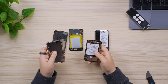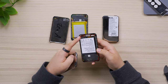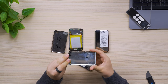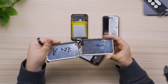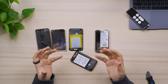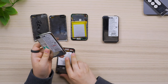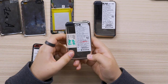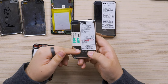After cracking this open, we can notice some differences. The most major one would be the actual board — from the little bits you can see, it's completely red. On the back, we have this same sort of Zen text, which they did for asset tracking or parts control on these early first-gen iPods. For comparison, let's jump into an EVT 2 iPod. This is later than the red board pre-EVT one, but still early. Notably, they actually put the EVT 2 label on it where you'd typically get the gigabytes.